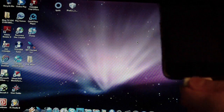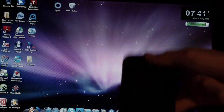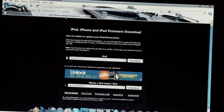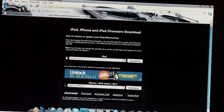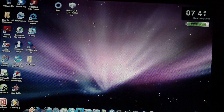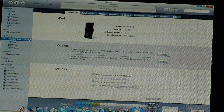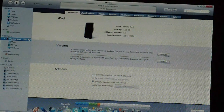Since I'm still on 3.0 on my iPod right over here — as you can see it's still jailbroken — I'm going to have to restore to 3.1.3. I'll give you a link in the description to the website. If you're already jailbroken like me, you'll want to restore to 3.1.3 firmware, select your firmware, and download it. Make sure you back up everything and have all your applications saved, because you will lose everything when restoring.